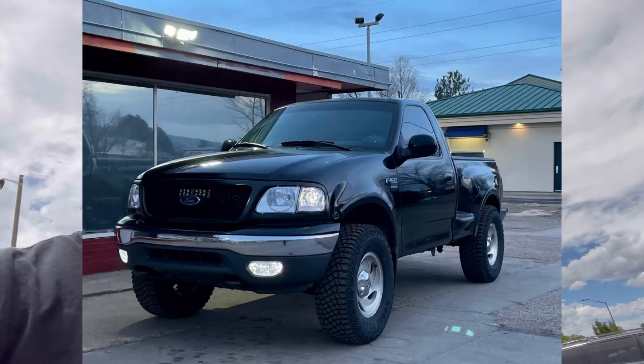We were going back and forth with some companies to try to get our hands on the tire sizes that we want — 285/55/22 — but we wanted them in a Toyo AT3 or the Nitto, and all the warehouses we deal through seem to be out of stock or on backorder. So we're just gonna push that to the side and I was able to come across a set of 33x12.50x22s that we had here at the shop. We're gonna toss those on the wheels, see how it looks, see if it rubs. The other F-150 I have rubs quite a bit so I'm not too worried about it.